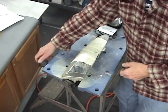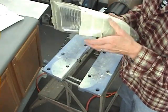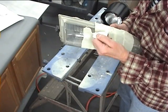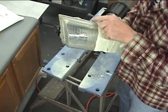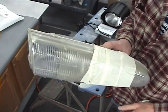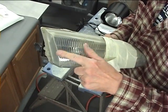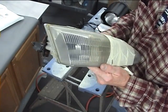Now let's just look at this — our flash time was up and we held the UV light for about two minutes. As I take this tape off, I'm going to move it to different angles so you can see how really cleared up this became. It's great — we have that original UV coating back on. As I switch it and turn it you're going to see how clear it really looks. A fantastic job with the Solar Ray UV system.